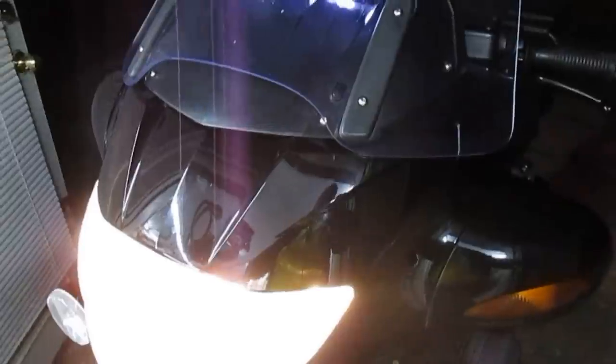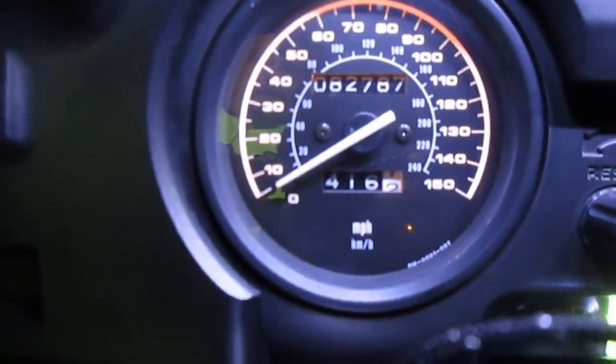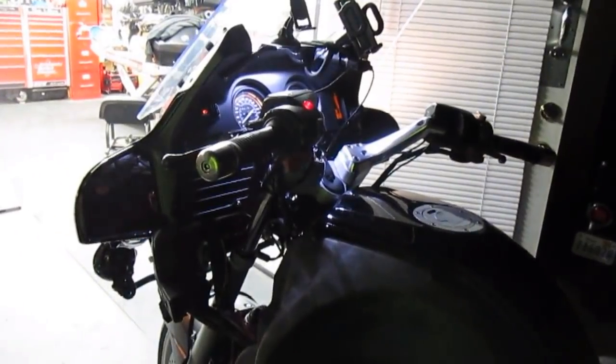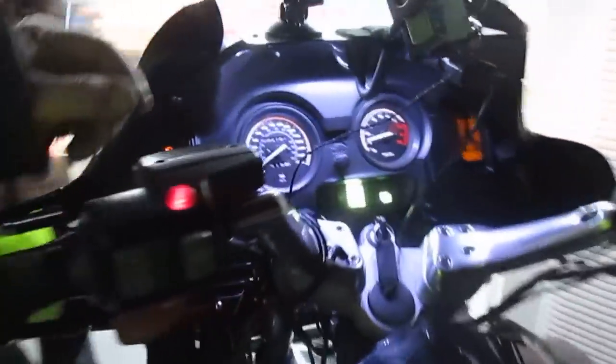We'll see how these shake out after I get it up to temp and I synchronize them, but they're probably going to need that throttle body shaft. It surges a bit at 3500, which I'd expected. The throttle cable is so far out of adjustment. The throttle's incredibly stiff to turn, so I'm not surprised with the mileage. They're probably original cables, so now we synchronize it.